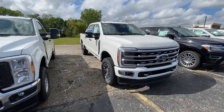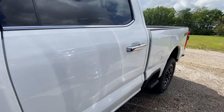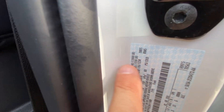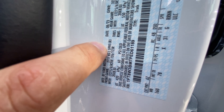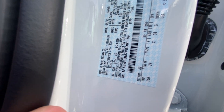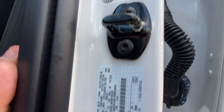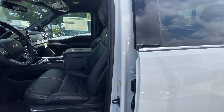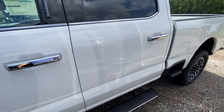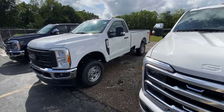Now here's another interesting variable. This is an F-350 short bed Platinum. All short bed F-350 diesels get a 12,000-pound GVW. The front axle rating is still 5,990 and rear is 7,230 — same as the long bed. But check out the payload: 4,054 pounds. So this is a unique situation where you can actually have more payload capacity with a short bed than a long bed. This truck has more capacity for carrying — pretty interesting.